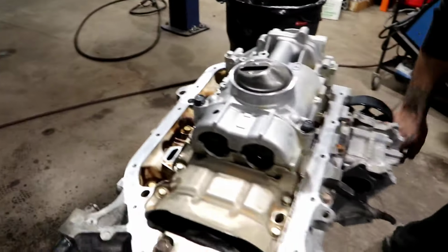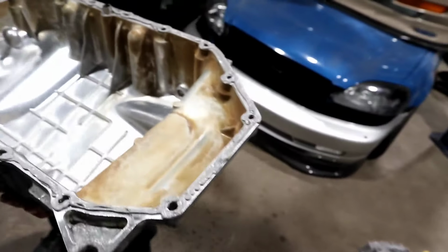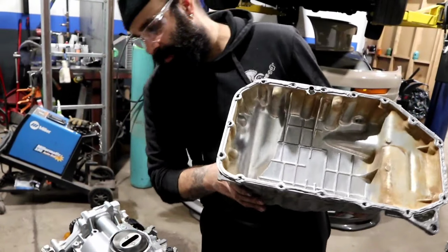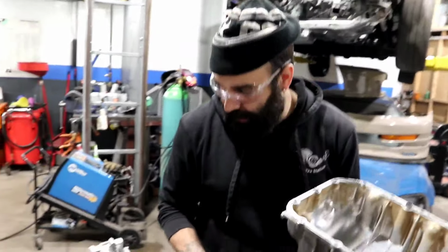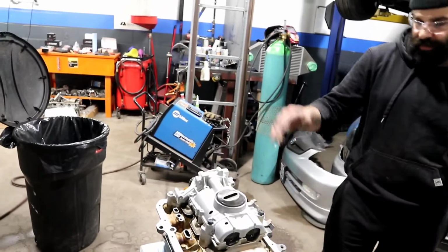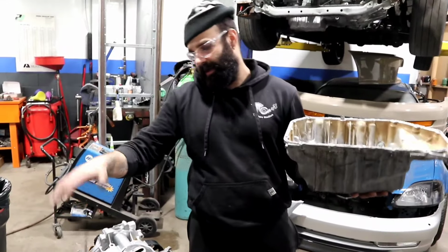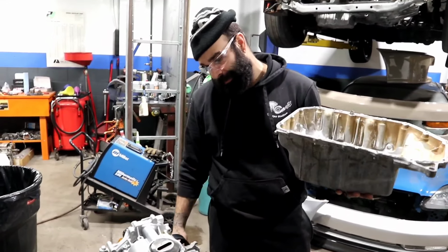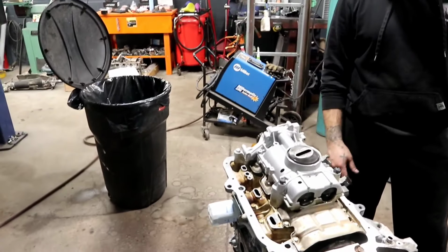So the base for where the oil pan goes, as you guys know, is all cleaned up. Mercer already has put the Honda Bond. Yeah, nice little bead all the way around for a good seal. And close it up. We've inspected everything. We've made sure everything was good. It's all there. Everything's clean. No debris, no nothing. No need to open this up. Everything was good with this motor. Further plans later on, we're going to change this pump into a Type S pump.